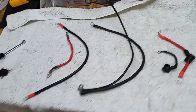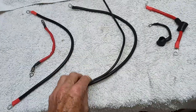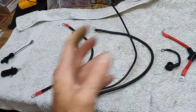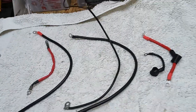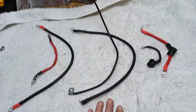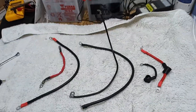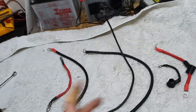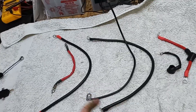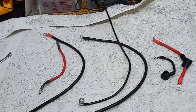I don't know much about electrics, but I do know that for a large amount of current you want a big wide cable. So why on earth Triumph NVT, in all their wisdom, fitted these puny cables in the first place — who knows. It's sort of basic electrics part one. So if your starter on any bike — same on the Norton Commando — is a bit slow, simply uprating these cables will give you 10 to 20 percent more power.